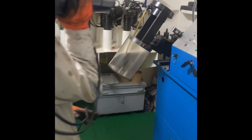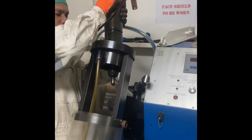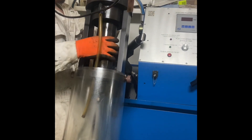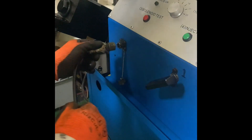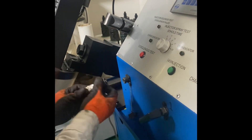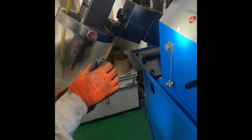After cleaning was finished, we took the same injector to test. Now you can see how we are testing the injector. Put the injection valve in position in the valve holder, making sure that the injection valve points down. Attach the injection valve to the valve holder with the spring cage and Allen screw, then attach the high-pressure hose to the connection piece. The solenoid valve connection also needs to be connected to the testing device.